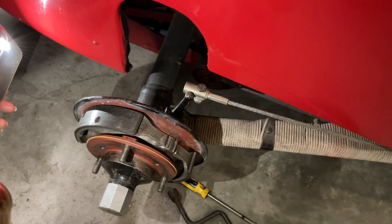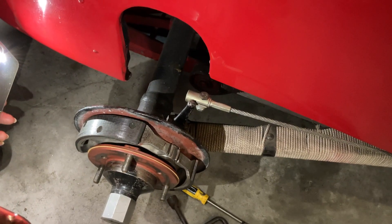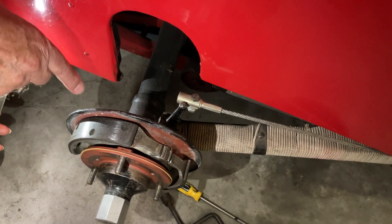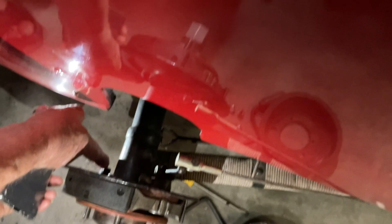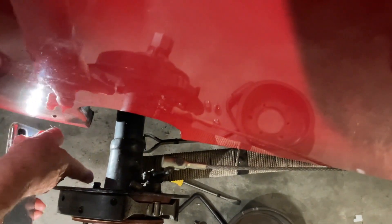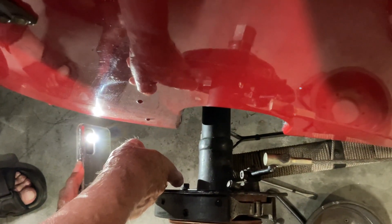This is the rear braking system. The first thing we do is remove this cotton reel at the back that holds the back end of the brake shoe. We drive it out — it has a long shaft on it — and then we make a new cotton reel and thread it 5/16th BSF and put a bolt in there.